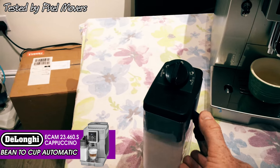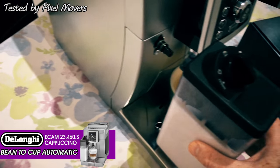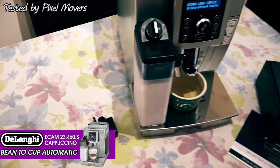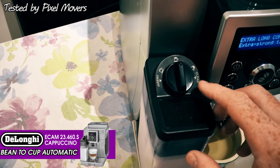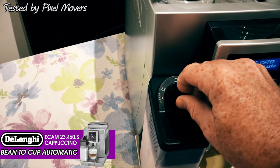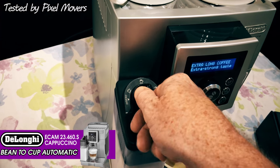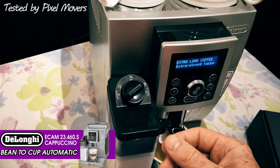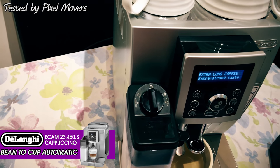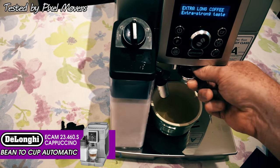The carafe has a little spout which pulls down so you can get closer or further away from the rim of the cup, and on the top there's a dial as well. You just push the carafe in until it engages and it'll beep at you once it's in there. That dial across the top gives you various different options for the amount of foam you like - small, medium, up to a large amount of foam. Setting it to around the 1-2 o'clock position will give you a decent amount of foam for doing latte art, which I'll show you later.